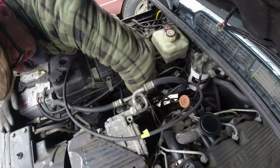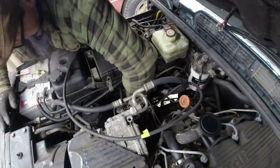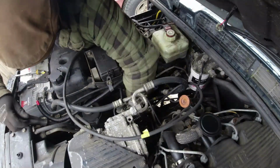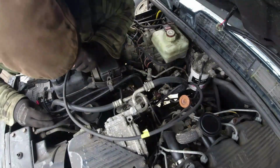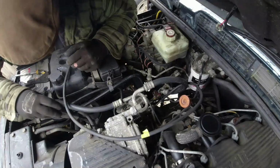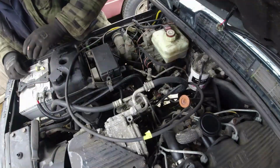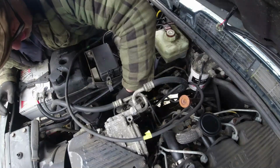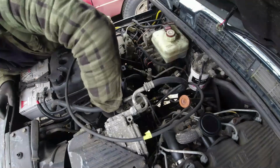There, that one. That's the one I want. Can I get in there with that? Because now I know the top end of the shaft is moving, I'm less concerned. Oh, the shaft is going through at the bottom here as well. I might as well just shift it off using the same method, putting the screwdriver in between the UJ and the end of the shaft on the steering box.